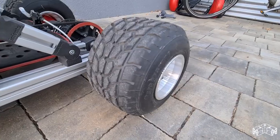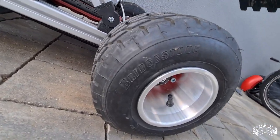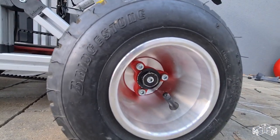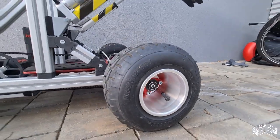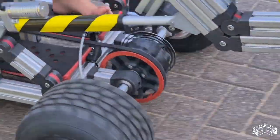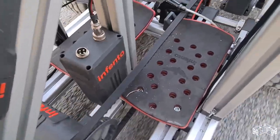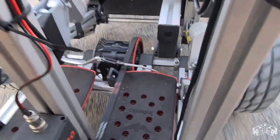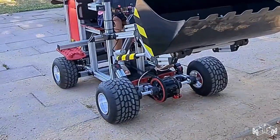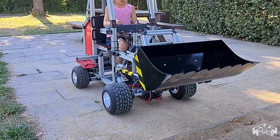The wheels are go-kart rims with rain tires. The rain tires with their soft rubber compound and rough tread provide better traction on loose ground. The small size of go-kart wheels has a couple of advantages: with their small diameter we can build very compact rides. A small diameter also means less torque for the transmission elements, avoiding a skipping belt and allowing a 3D printed plastic differential. The kart wheels also have a very cool look, and due to their great width and flat track, they don't sink in on grass, sand, or mud like Infento's narrow 8-inch universal wheels.